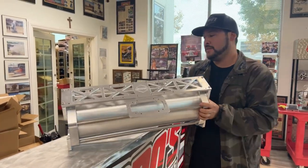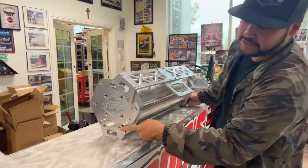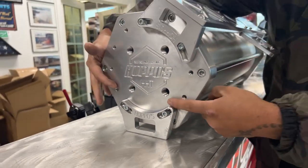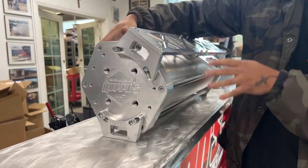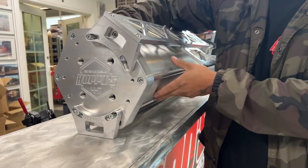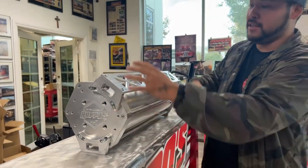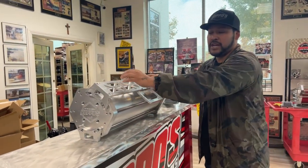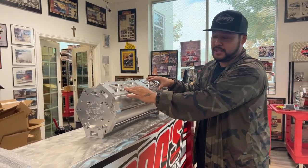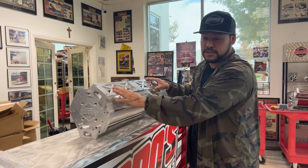So this one has a lot of options. It's very modular. The nice part about this is it gives you the mounting brackets down here at the bottom, but it also allows you to mount this in any which direction using all of our mounting holes. So if you have a weird angled platform, you could put those mounting holes on the back to look like this tank is floating. Also, you can rotate your compressor mounts as well. This is set up for Viair 380s, 480s, 444s, and 485s. So it's universal as far as the mounting configuration on the most commonly used Viair compressors.